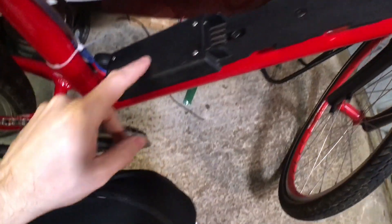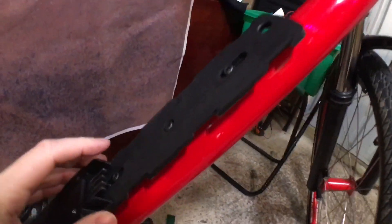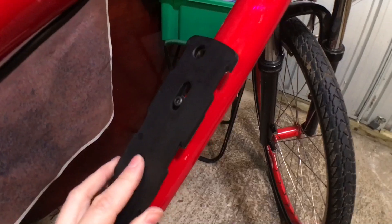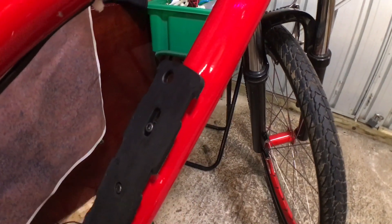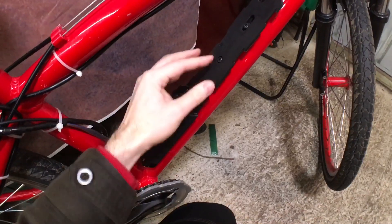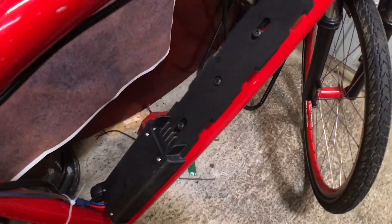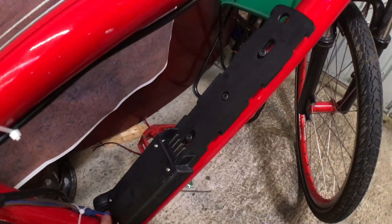Let's quickly take a look at the bracket on the bicycle. It's all plastic. Underneath there are four screws, and on the other side there is a metal piece that mounts through a bottle cage. I drilled a hole through the metal piece and put a bolt through there to hold it. I also added two extra bolts up top, drilling into the frame, tapping those holes, and adding bolts to make sure it was really sturdily mounted — because I've heard of people with just the two mounting points having them completely rip off through the plastic, since there's no metal at the top at all. Underneath there are just two wires coming out and connecting to where the controller goes.